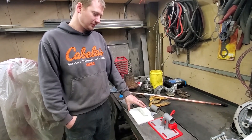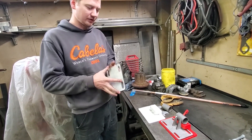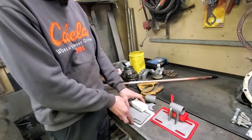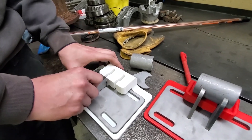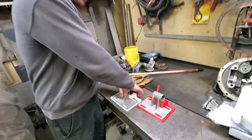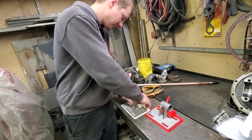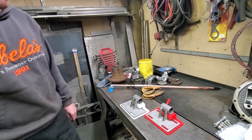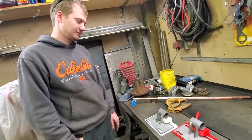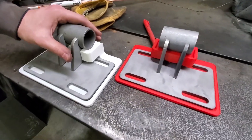We made some engine mount jigs. After I got the engine mounts designed up, I wanted a way for us to be able to make them easily, so I just had my brother 3D print a little jig that all the pieces will sit in. Because those bushings are angled — there's a little bit of angle to them because the engine will sit at a little bit of a downward angle, so that was designed into the engine mounts. That's why there's a right and a left — one goes one way and one goes the other way — so that way I can't screw it up when I weld it.